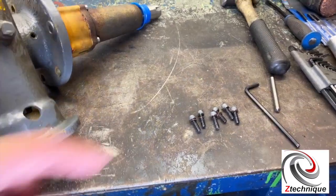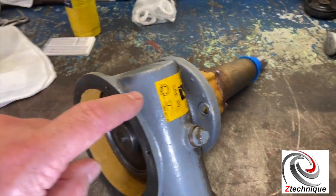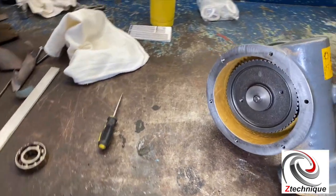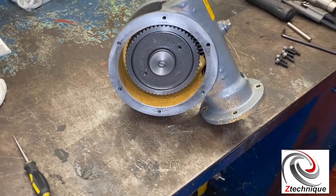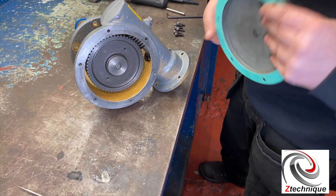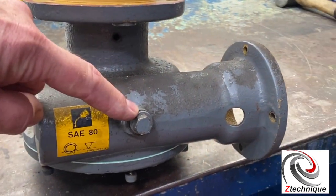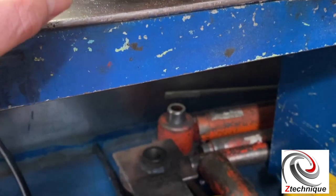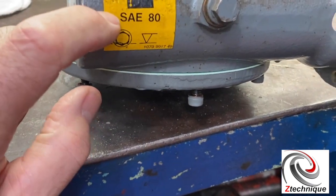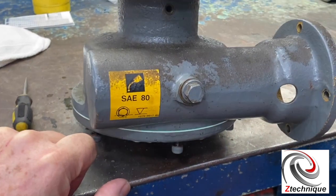Just a point on fitting the cover — each one of these fasteners has a copper seal because you've actually got oil in the gearbox. We don't put any oil in at this stage; we only put the oil in after we've fitted the cover. We fit a new gasket on the cover as well. You fill the oil through this port here, and when you get to the fill line inside the gearbox that's sufficient oil. Don't overfill it, and of course don't forget to put the oil in or you'll have a very short life of the gearbox itself.